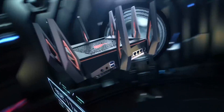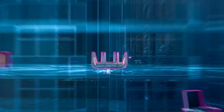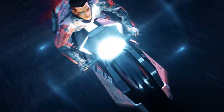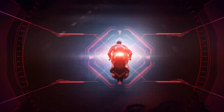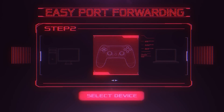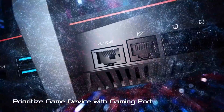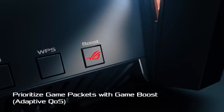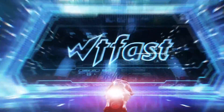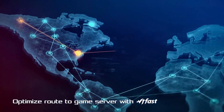This Wi-Fi system is great for families, small offices, apartments, or multi-story houses. The Asus ROG Wi-Fi 6 router supports OFDMA and MU-MIMO technology, letting the router communicate more data to more devices at the same time. Wi-Fi traffic is managed more efficiently since data is transmitted from different devices simultaneously rather than waiting for each device's turn. This results in efficient use of airtime, reduced latency, and increased bandwidth — increasing Wi-Fi data rates up to 60% for lag-free online gaming and even 8K streaming.